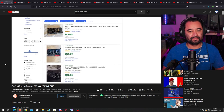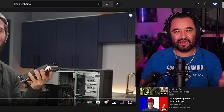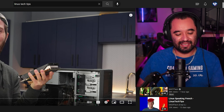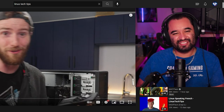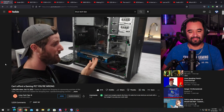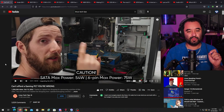Back when they prepared this video, RX 580 prices hadn't yet been annihilated by the Ethereum merge. The RX 580 is what I went with on the most recent video on this channel where we analyzed the Z440 as a budget gaming option for under $300. And I think he does end up going with one of those - good choice for a budget GPU right now. For these budget builds, definitely go with any GPU that has just a single power plug. Don't use SATA to GPU power adapters.